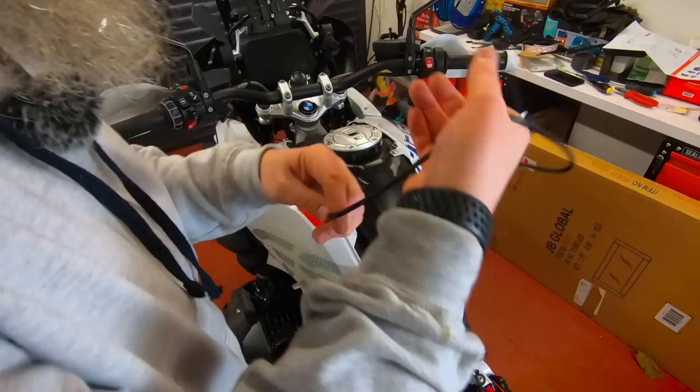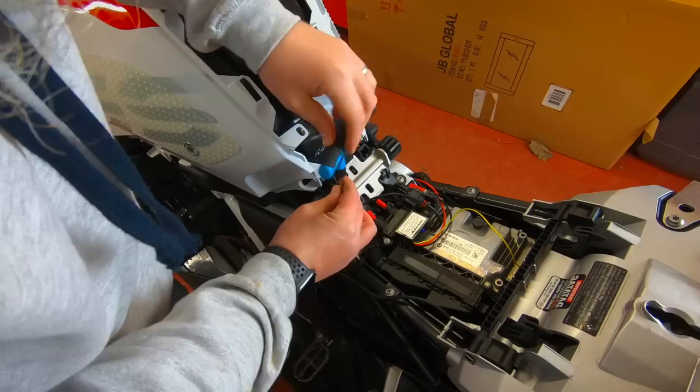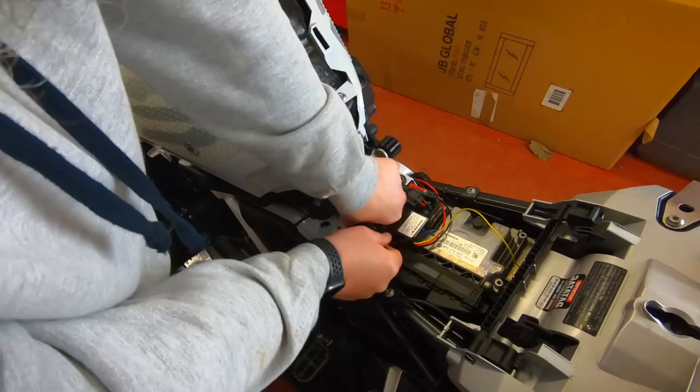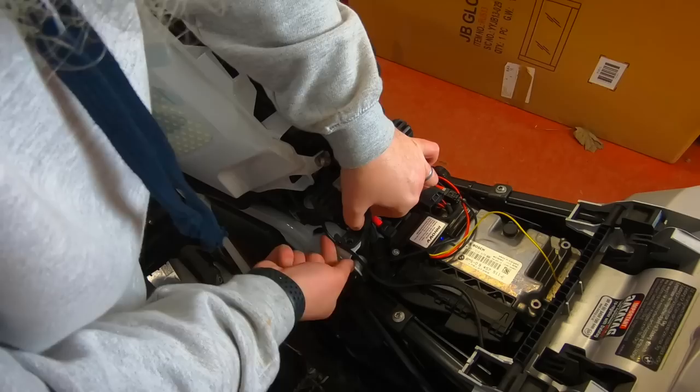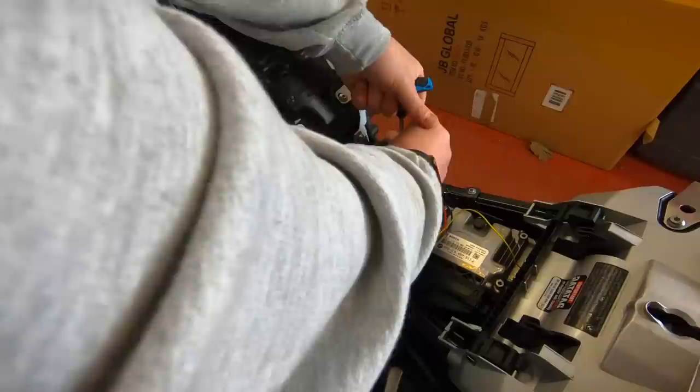Rear camera cable. You can see these cables need to go under this black bracket — unscrew that one and this one — that gives just enough play to get them underneath without biting on anything. Same with this cable, I want that underneath there as well. Okay, I'm happy with that — whack these back on. Now we just have to connect all the wires up to the front camera — the DVR module — make sure everything switches on, and then we can tidy everything up.